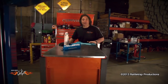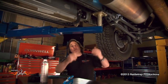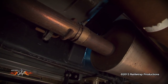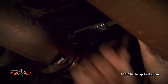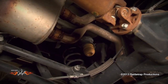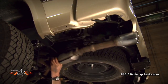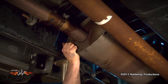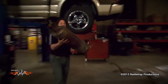In the past, the idea of crawling under a car or truck and messing with an exhaust system was about as desirable as getting your teeth scraped — they were always rusty, never came apart well, and you spent all day messing with them. Well, that has changed since most OEM mufflers are held in place with removable clamps. Now it's just a matter of unbolting everything. First, lube everything up nice and then loosen the bolt clamps. Next, slide the tailpipes out of the muffler — a pry bar or rubber mallet will help if they try to hang up on you.